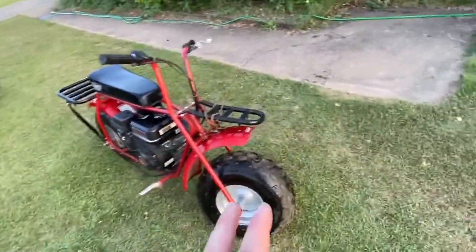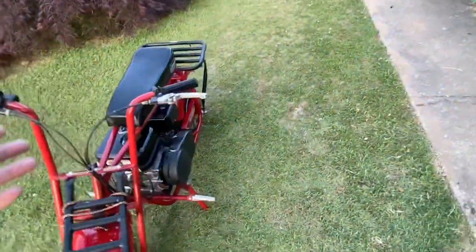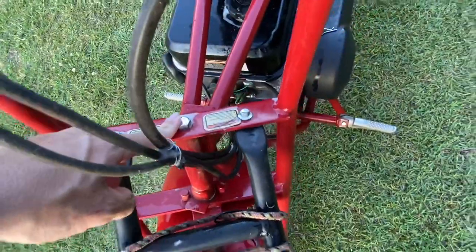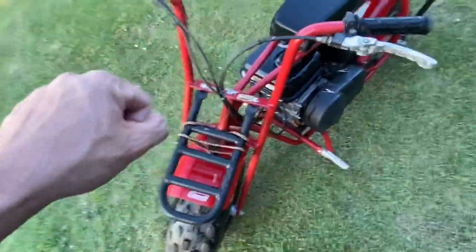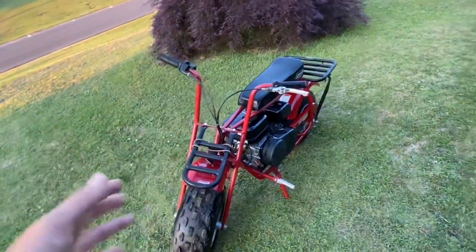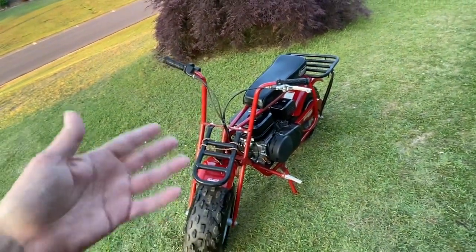These wheels will vibrate loose. The wheels, brakes, they have to be adjusted. This thing right here, this bolt will come loose. Because you're hitting bumps constantly. Boom, boom, boom. This, and then there's a nut that connects to it right there. It vibrates loose and you have to tighten it. And if you tighten it too much, it gets kind of stiff. And that's how I like it anyways on there.